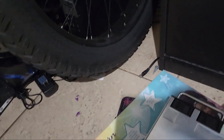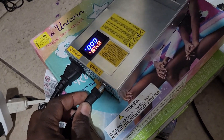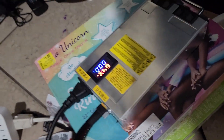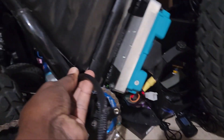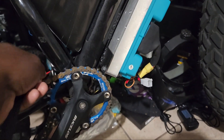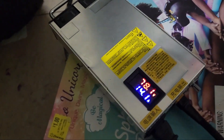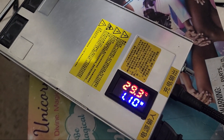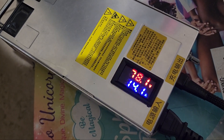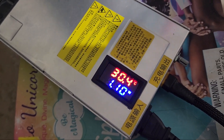The charger has started. I'm gonna go ahead and get the charging cable, plug it in here at the charger first — all right, that's plugged in — and now we're gonna plug it into the bike. And as you can see, that is actually charging at 14 amps. That's the max it can really do — sometimes it starts at like 15 but usually runs around 14.9. It's actually charging the battery up now.